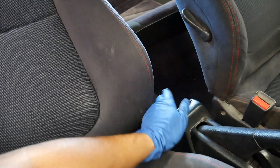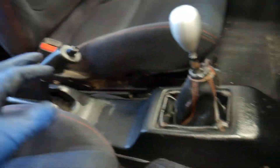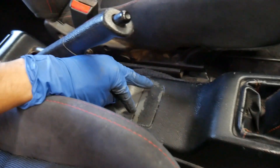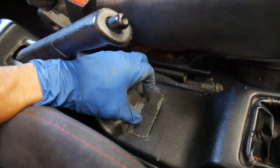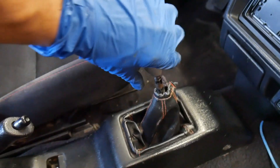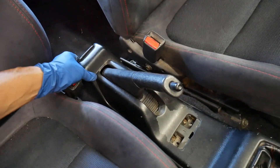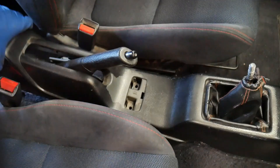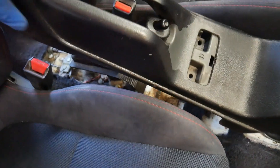I find this the most challenging part of doing the rear disc brakes — everything else is pretty straightforward with all the nuts and bolts. Let's get this console removed. You have two screws, one on each side, plus two more underneath. Pry up this little plate from the front and there are two more Phillips head screws. Next, go ahead and remove your shift knob. To get the console removed, slide it back a little bit — there are two tabs it slides into. Push it back, then lift it; it's easier if you pull your e-brake handle all the way up.